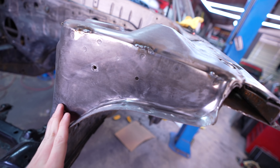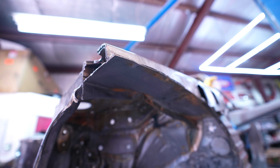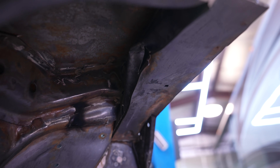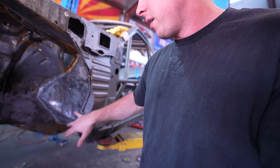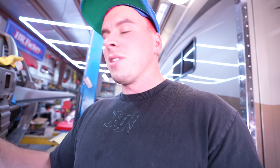It's obviously all trimmed up, got everything kind of much closer to where it's gonna be. There's this weird thing with the R32 chassis where it has this crazy lip under here. We were actually contacted because we were higher than the recommended ride height, so it's not like we were running crazy low. We are allowed to fold it over — generally you can't modify the upper area, you're allowed to cut forward of the forward-most suspension point and smash in the lip down here inside. We had to get approval from Formula Drift for that. It wasn't quite what we wanted, but we'll be able to make it work.